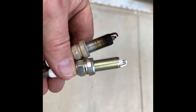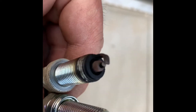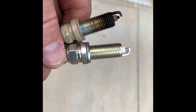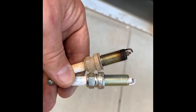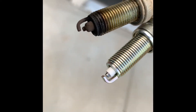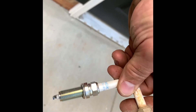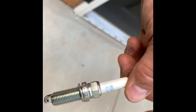That's the removed plug compared to a new plug — worn down a little bit, could use some help. We are changing them for a reason; that's at 600 miles, believe it or not. The back cylinder plug was a bit worn, and the front cylinder was burned just a little bit darker. These are NGK plugs.